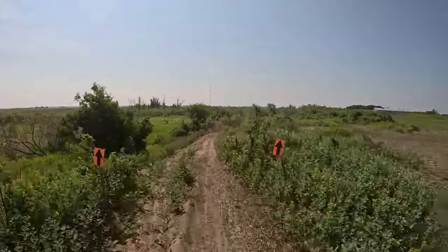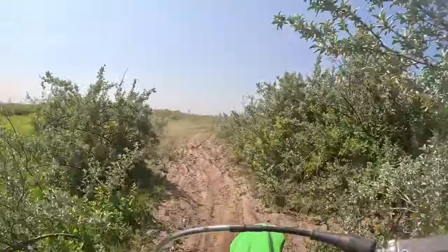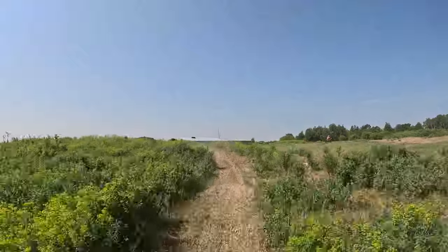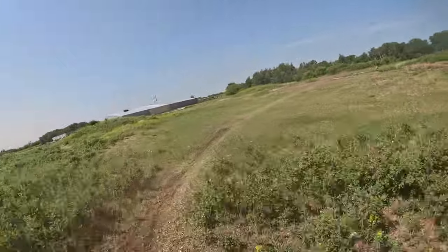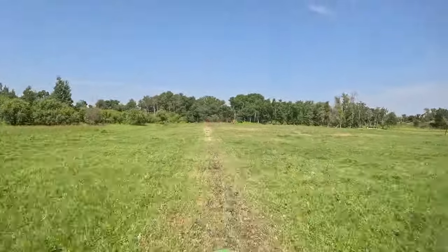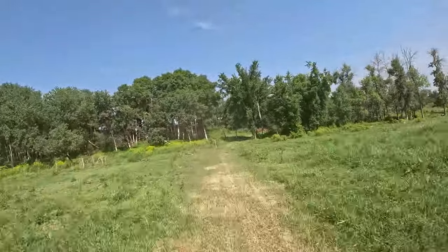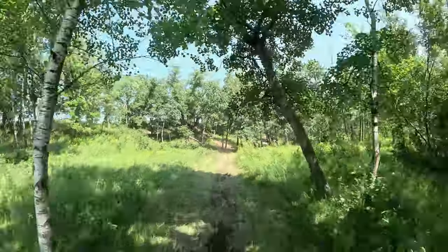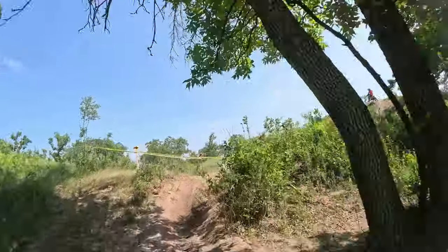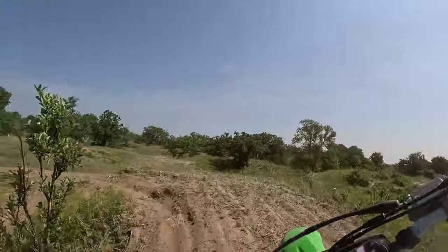They sell this in an interesting way — a lot of pictures show family rides — but realistically this is closer to the race bike than the F series, which are the true trail bikes. It should still be an extremely powerful race bike, more suited for GNCC or longer races. The front tires are beefy compared to the race model: 90/90 on a 21-inch rim up front and 110/100 on an 18-inch rim out back. That gives you better control, easier climbing, and better acceleration — all about getting up to speed rather than maintaining it.